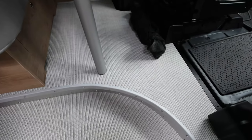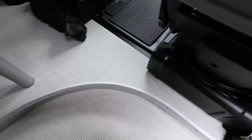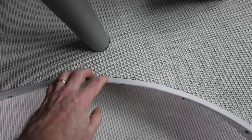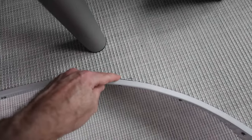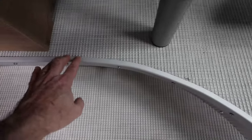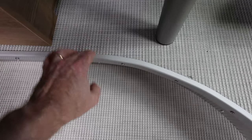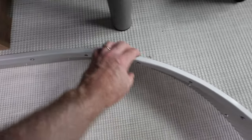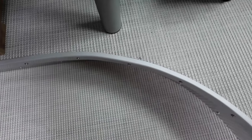For the next repair I wanted to focus on this lovely piece of curved trim that Airstream put in. I do like the aesthetics and it's well designed, but unfortunately it wasn't particularly well put together. The trim actually doesn't come to the edge of the curve of the floor - there's a bit of a gap, and you can see the staple here. Even worse, this trim here is actually quite sharp on the edge - I scraped up my bare feet on that. So we're going to need to file that down so it's nice and smooth, and I'll see if I can cinch this in and close up that gap.